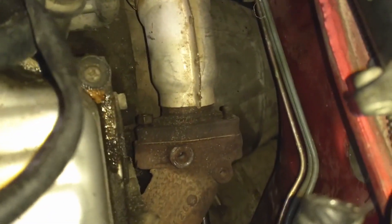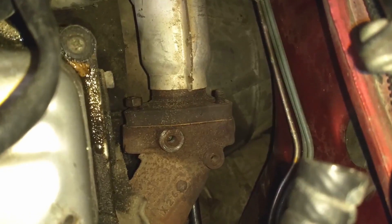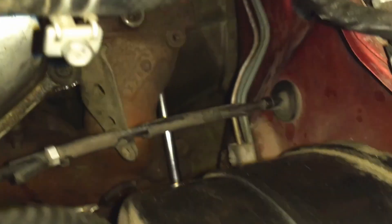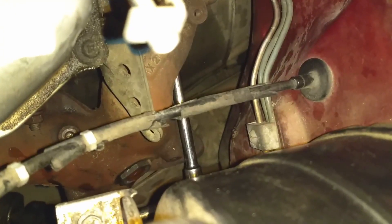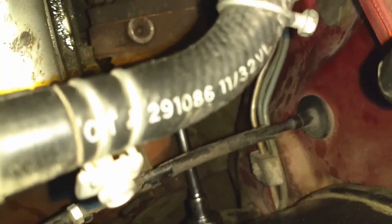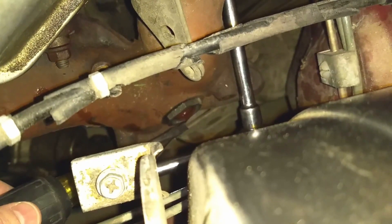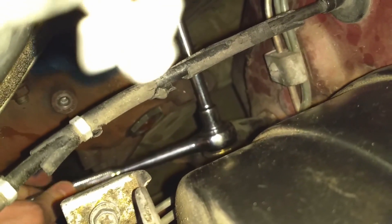I'm working on getting the bolts off the cross member on the exhaust manifold. There are two bolts on top that are easy to access — one's loose, the other is already off. Then there's a third bolt on the back side. To get that back-side bolt off, I have a six-inch extender with a regular shallow socket and the ratchet attached — it gives me just enough room to reach it. Also, right here is an O2 sensor. I pulled that out because if you leave it in, it hits your ratchet and you're unable to do this. So pull that out, use the six-inch extender, and that makes it pretty easy to get that bolt off the back side.